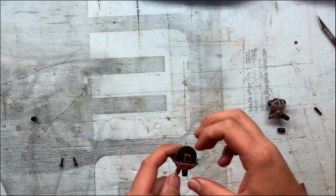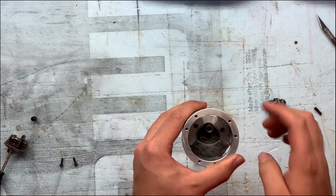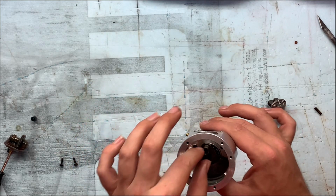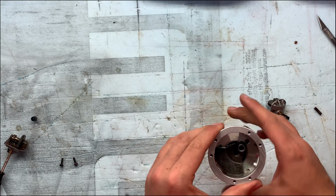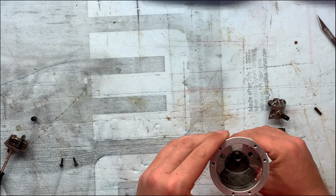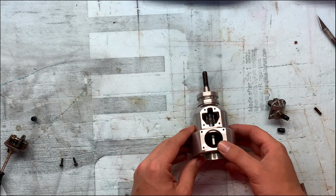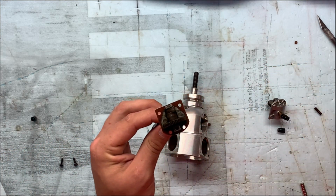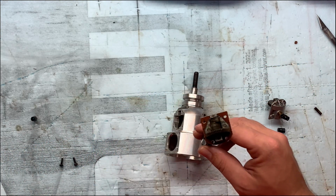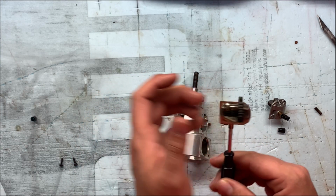And that is where we want to put this cam gear cover on when the crankshaft pin is at TDC, or top dead center. So anyway, let's go ahead and time this. Let's put our crank pin right in here, at top dead center. I've got a gasket on this cam gear cover number 1, and it's locked in place, and I see the dot right at the bottom where it should be.